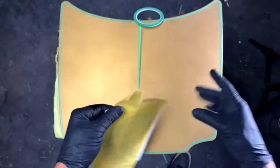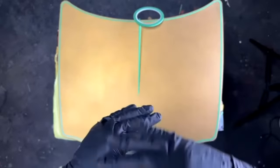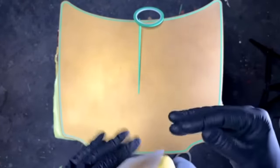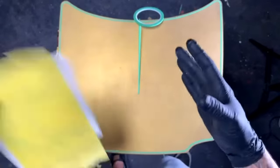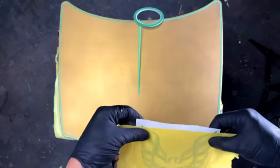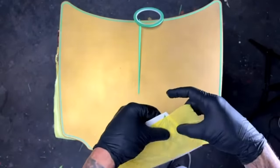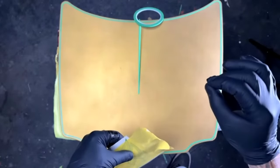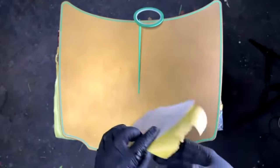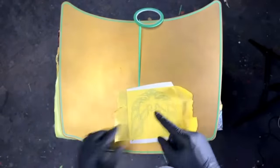One thing I could say is don't oversaturate it, because once it lays over and gets really thick, that's when that happens a lot. So when you're spraying on white, it's better to go a little bit less. Sometimes you have to rethink how you're going to do it, if you're doing ghost flames or something like that. Sometimes adding just a little bit of a blue candy to that mixture could help. But yeah, that's one of those things that's real hard with those. I'm going to go ahead and stick these together.